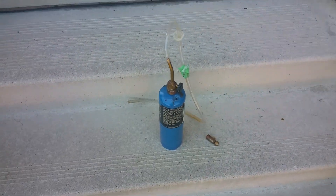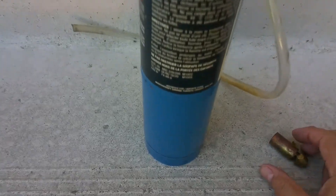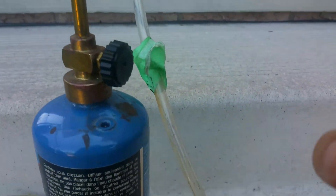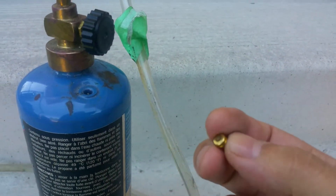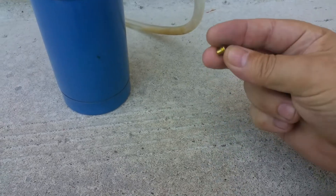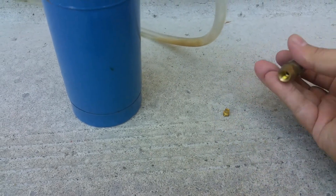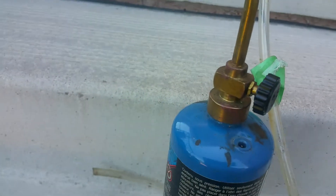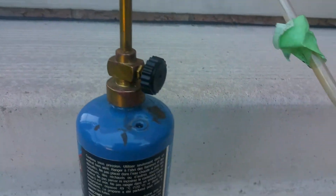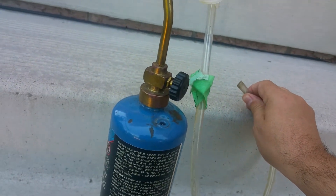A better method in my opinion is using a propane bottle to find vacuum leaks. All I did was remove the nozzle — it just unscrews from the neck. There's a small valve orifice inside, so don't lose that. I stuck in a quarter-inch tube that fits perfectly and creates a good seal. Whatever length of tube you have, this lets you pinpoint the vacuum leak more precisely than water, which goes everywhere.